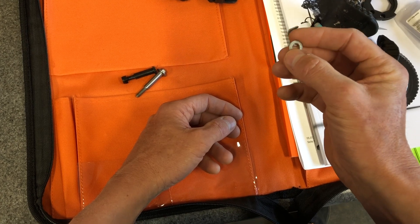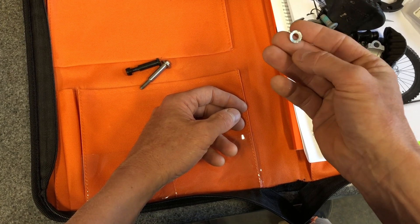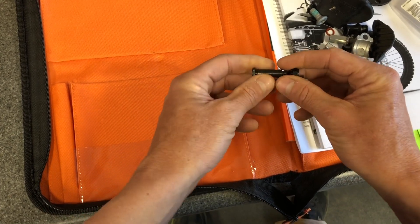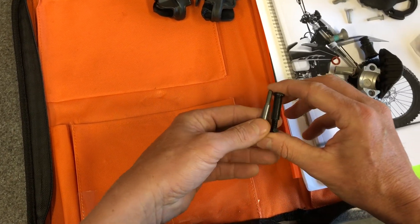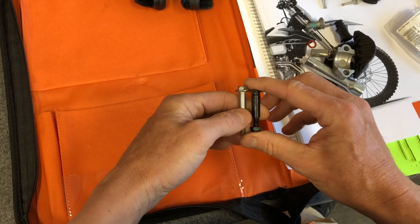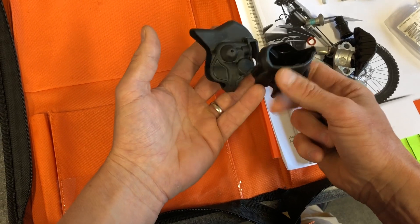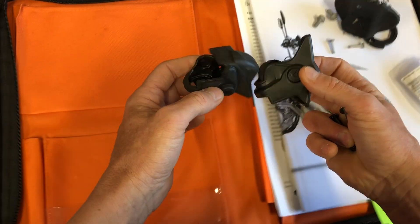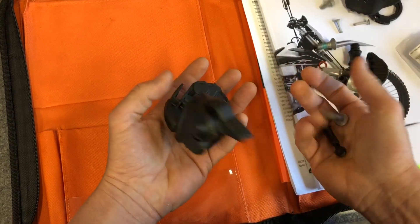The grounding strap comes off your battery and goes to the aluminum subframe on KTMs. They give you an extra star washer because that is kind of a weak point — it provides electrical bonding between the two. These are for your clutch and brake lever. If you're going to take off your stock flags — those are your hand guards — and convert to standard wraparound bark buster guards, the bolts that hold the flags on are longer, and they give you the shorter replacement bolts. You can convert over to the off-road setup which doesn't have the flags.